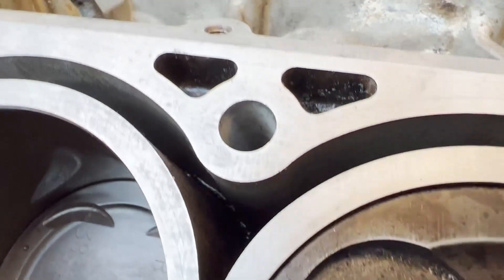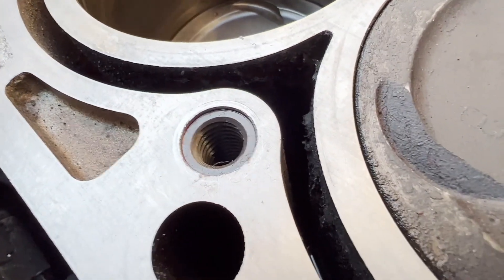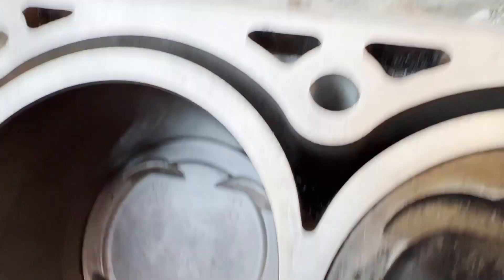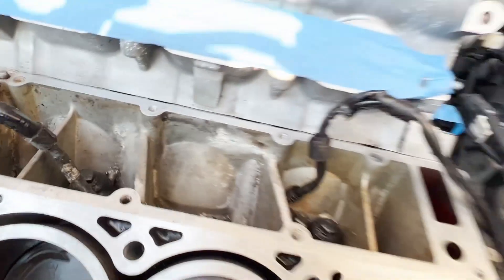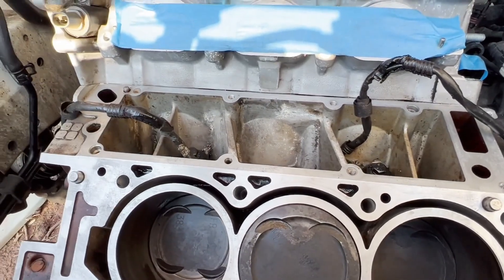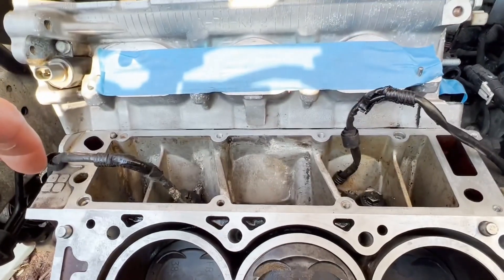This was an effort to be slick and save a lot of money. In the long run, this will work once I get the correct OD insert to match this hole for the biggest bite. The approved repair is to repair those threads way down there, and that TimeSert is like $500. This kit with the inserts and stuff was under $200, so it seemed like a worthwhile shot and it still is.